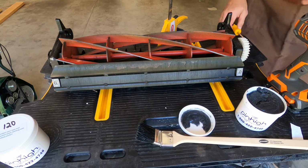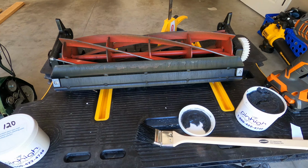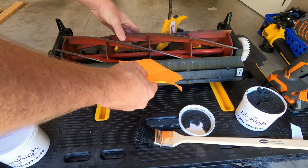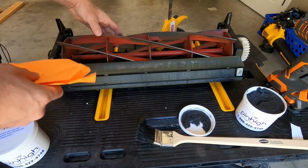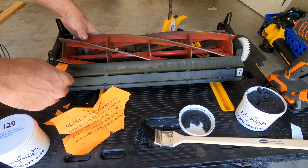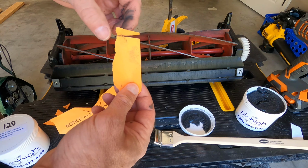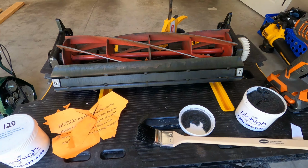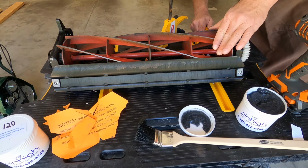Let's bring it down one. Well, let's do the paper test and see how that edge is looking. Start in the middle. Clean cut. Very clean. Like this, right on the edge. Yeah, that's a good example. The blade was right there on the edge. That tip's still not making the cut, so we will click one more time and bring the reel down just one more notch.